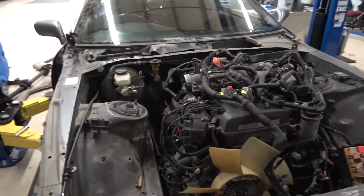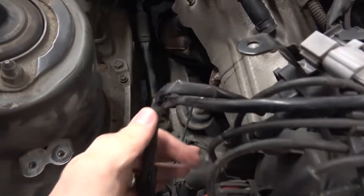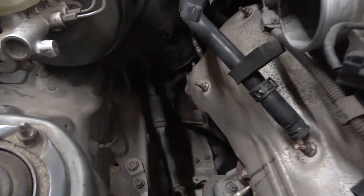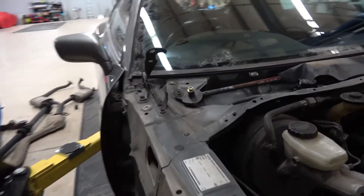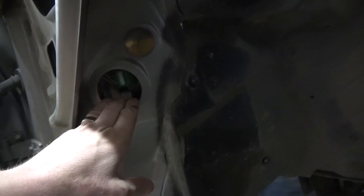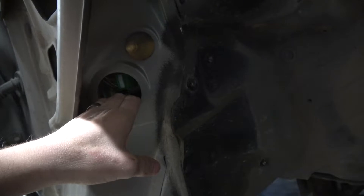Okay guys, I think I'm ready to pull the engine. The steering is loosened off. I'm hoping as I drop the engine down it comes up a little bit because she's a little stiff and I can't get it off. The rad's out, the air conditioner condenser's out, and the wiring harness was extremely difficult. It goes in here and you can see the control box under the driver's side - extremely hard to get at because it's underneath all the pedals and up underneath the dash.